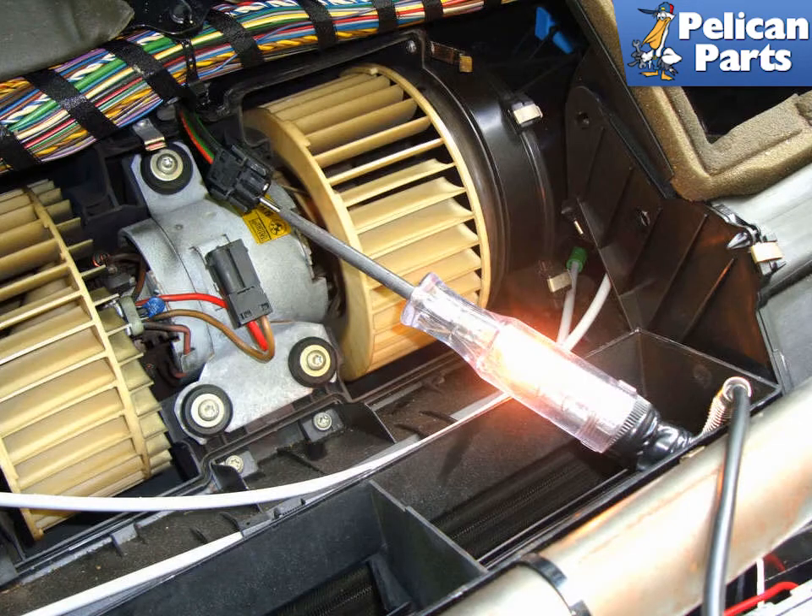For the rest of these tests, unfortunately you will need access to the blower motor, so you are going to need to remove the dashboard. Please follow the link provided at the end of this video for additional assistance with that task. With the ignition key on and the IHKA control unit on, you should have battery voltage at the blower motor on the red-green wire. For the 97 540 the wire is red-green, but you will need to get the appropriate wiring diagram for your year and model.